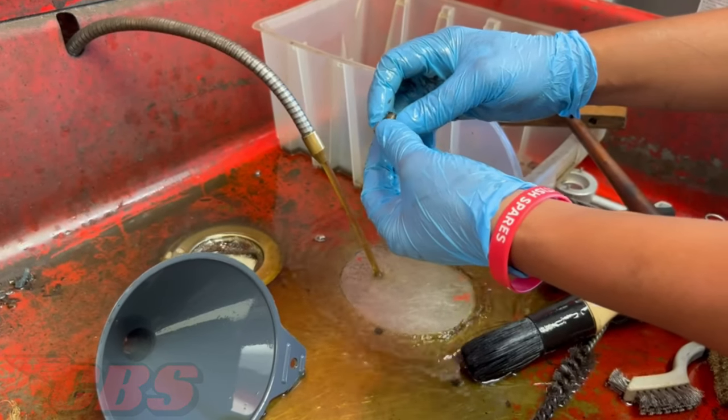We're actually going to put this oil inside the oil tank — we got the funnel nice and clean. Before we finish putting oil in the tank, I wanted to stop and visually look in the tank to see the oil level. It seems like we're somewhere down here. Now this is a 1968 bike — it might be irrelevant to some of you, but it might be relevant to many that don't have a dipstick on the actual cap. This one doesn't have a dipstick on the cap; it goes off the filler neck as far as the dimension down to the oil. I don't have the dimension with me at this second. Oil acts as more of a coolant — it actually cools the engine, lubricates it, and keeps it at a good operating temperature. So let's put a little bit more oil in there and check along the way.